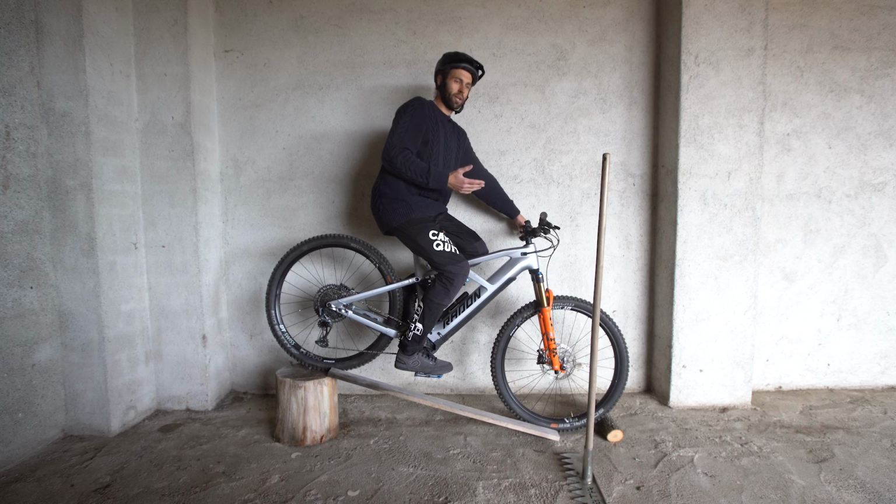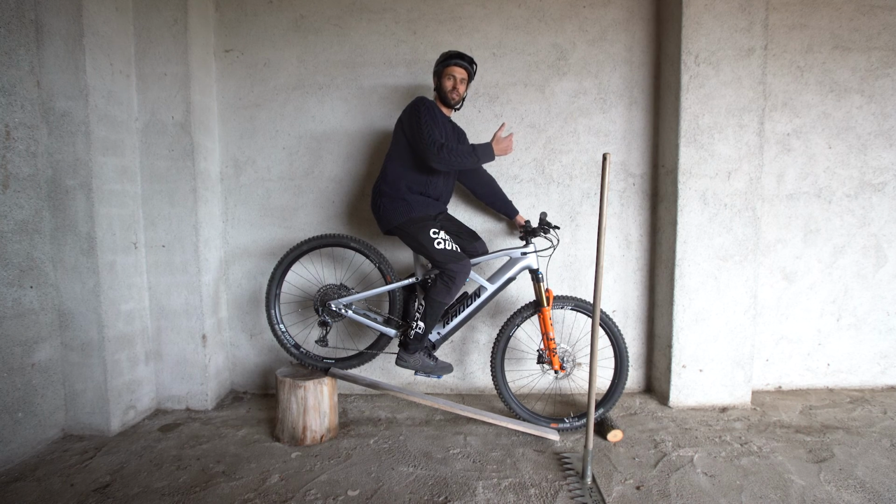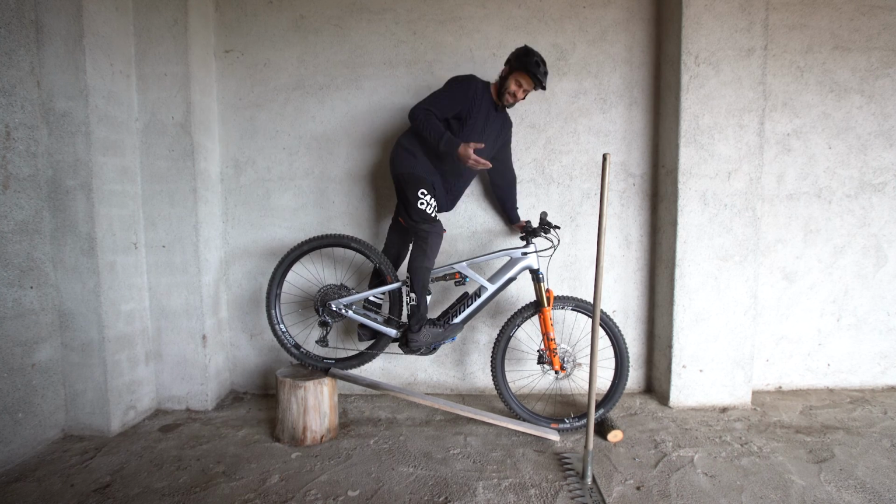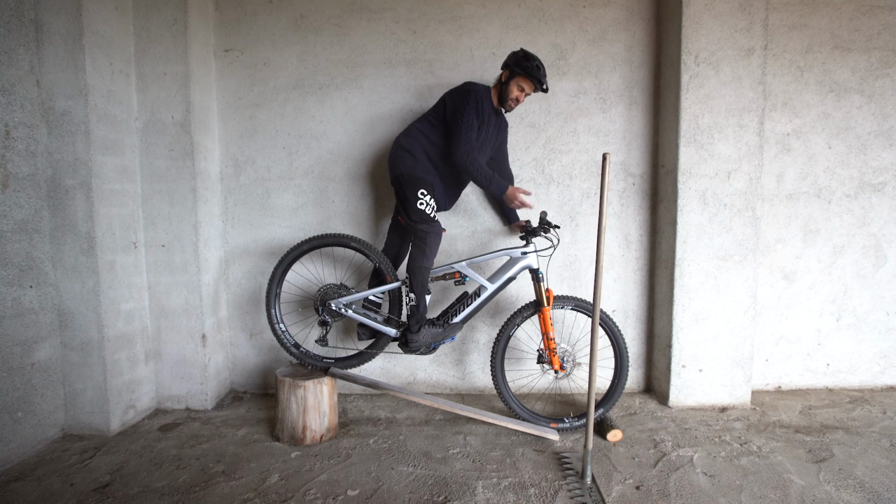But for proper mountain biking, the stem length should be used for the bike handling and control. And if you need a longer frame size for taller riders, the frame has to get longer, not the stem. Making the stem longer causes other problems that we don't need. In this case, the extra large has got a 60mm stem.